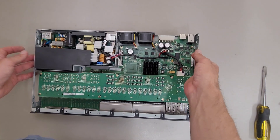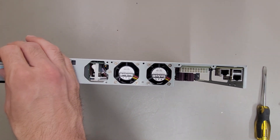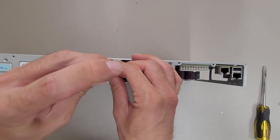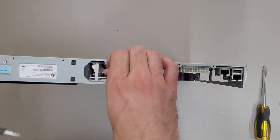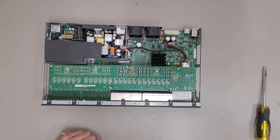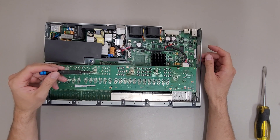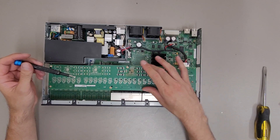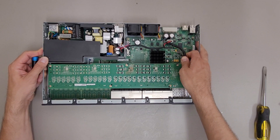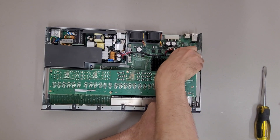I've taken the liberty of removing most of the screws already since there's a lot of screws in this unit. I'm going to remove the power supply screws while I'm at it. With these POE switches there is a beefier power supply involved along with some different support infrastructure for the POE power. The 24T variation of this switch won't have this riser board and I don't believe they bother with installing the pin headers either.